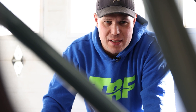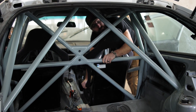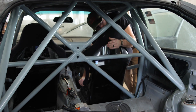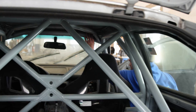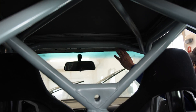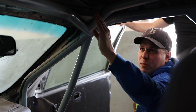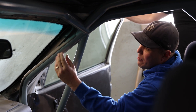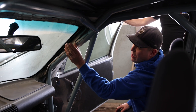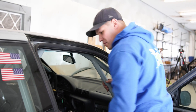One thing this cage does do a pretty good job of, Chris, is the general fitment is nice. The main hoop is tight up against the structure and pushed outward. They did a good job. I have seen in other instances where this tube at the windscreen is too far aft — this one could have been pushed forward a little bit, but they really did a pretty darn good job. You could have a builder put this tube too far back and it becomes an intrusion near your head, or sometimes these A-pillar tubes can be projected inward and they start to block visibility. So a lot to be said about fit and finish.